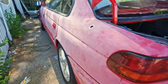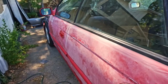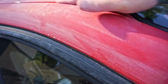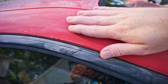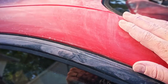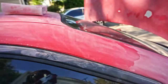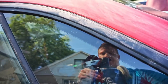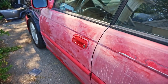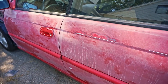It takes a really long time, but the biggest thing you're looking for is this: you can see here this area is still glossy — I haven't done the drip rail yet — but this whole area here has a flat finish. That's what you're looking for when prepping your car. You want the whole car to be flat before you spray or take it to someone to spray, because that's what ensures good adhesion with your new paint. Get your whole car non-glossy.